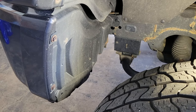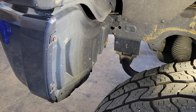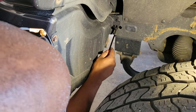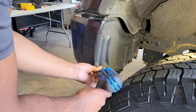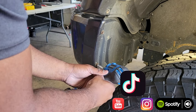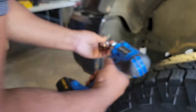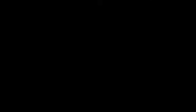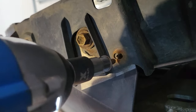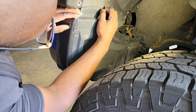When you go to replace the fog lamps, you'll notice that there's a plastic guard in front of the fog lamp housing, and there are four bolts and one clip holding it in place. It doesn't matter which order you remove them — bottom bolts first, side bolts, the clip — just take them all out. Once you've removed all five connection points for that guard, you can carefully remove it from the bumper and get it out of the way.